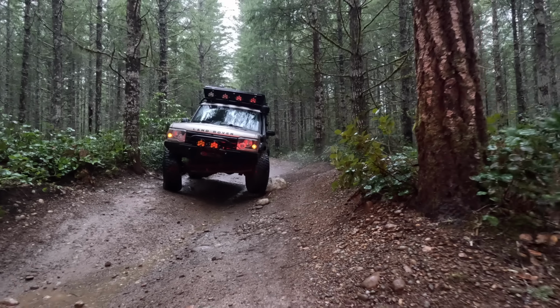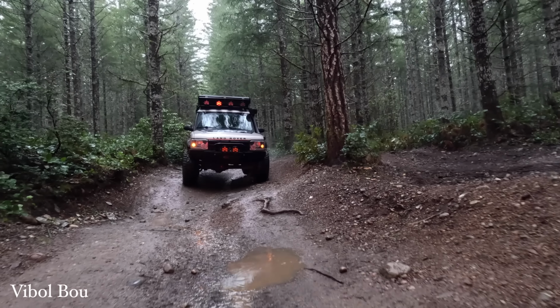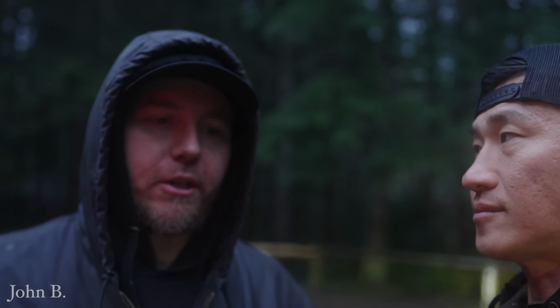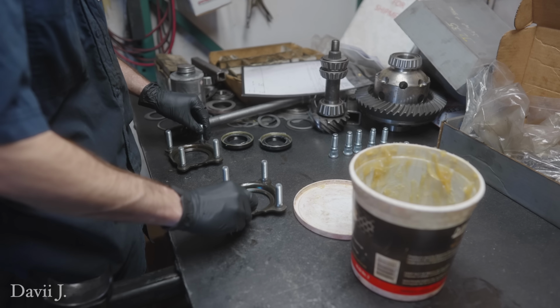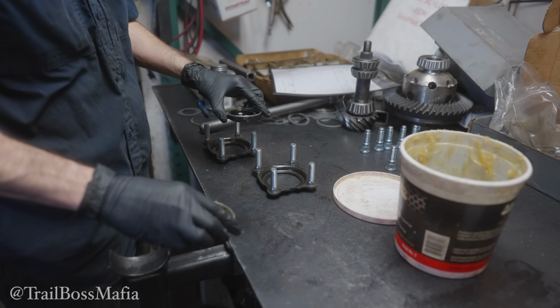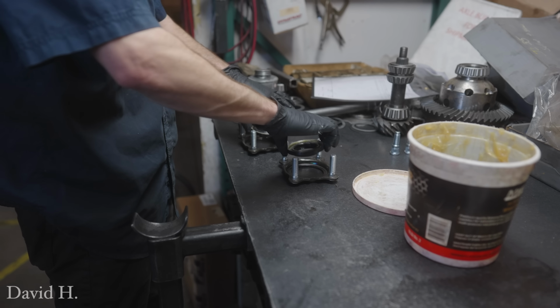40-inch tires on Dana 44s. Well, on Dana 44s, it can be done with a lightweight vehicle. With the Dana 44s in this Jeep, I think it's very noteworthy that there's a massive difference. Like on my TJ, I have a Dana 44 from a '76 F-150 that is miles away from what these are. These are like the most efficient axles that have ever been invented as far as the ring and pinions. It's much less clamping load on the bearings. They're incredible. And all the bearings and everything are huge for a Dana 44.